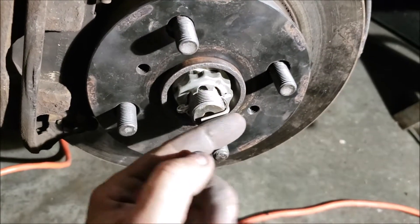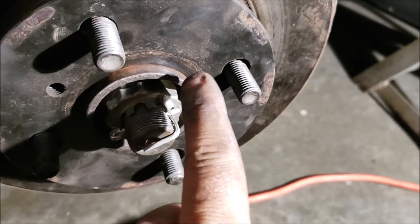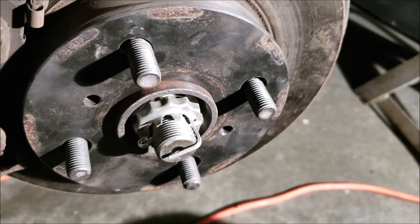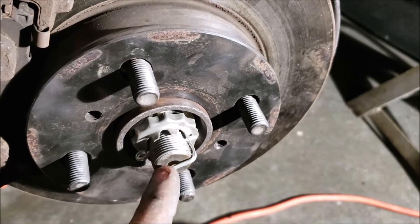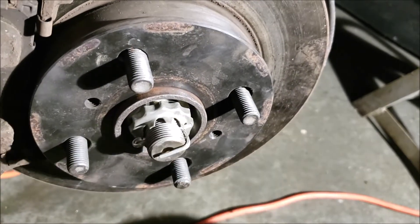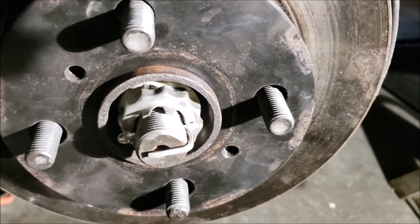You want to make sure your longer leg is to the outside so you can bend it out, and your shorter leg to the inside. You don't want to bend two legs because then when you straighten them out, that's two kinks you're going to have to pull out. I actually have a video on how to properly install a cotter pin — it's become kind of controversial because most people do it wrong. You'll notice on all cotter pins there's a little notch so you can bend one leg, not two. You just bend it into place, give it a nice little tap, and it's a done deal.